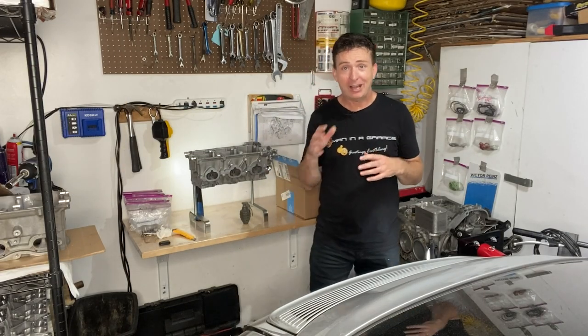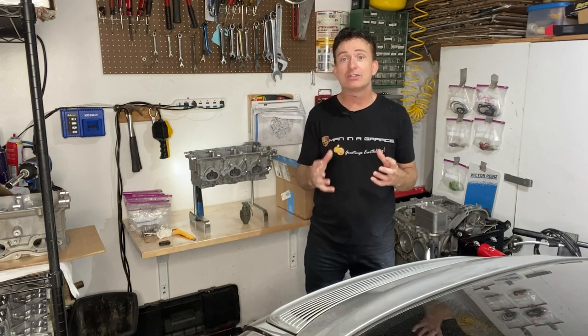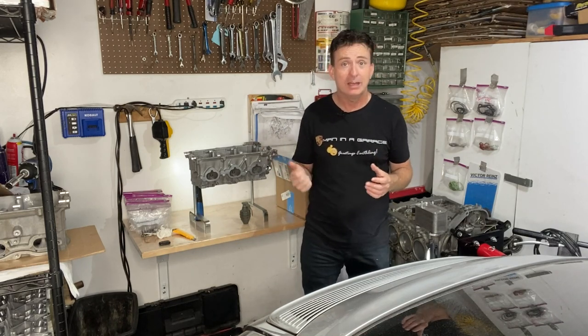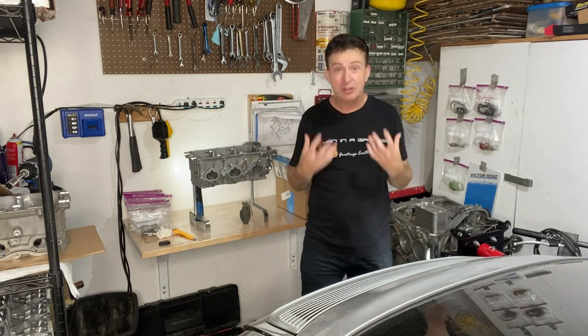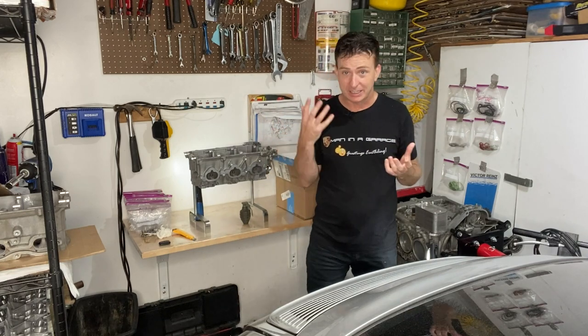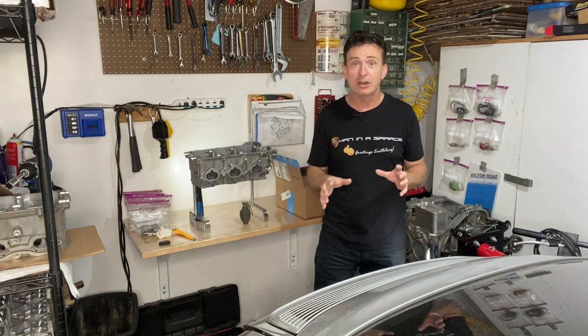So there's our venture into valve lapping. That whole approach really was guided by the fact that we brought those cylinder heads to the machine shop, and their expert eyes told us really there's not a whole lot to do. We could fix the majority of everything and make them look lovely just with lapping, and so that's worth knowing.